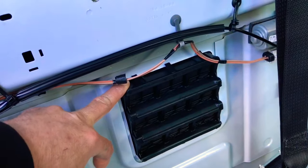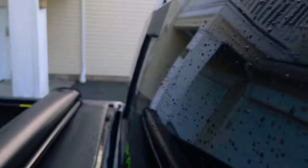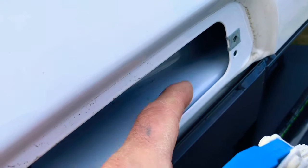So that was step one — the window — and step two was the vents. Now what I haven't done yet is put water in at the third brake light. I've got a squirt bottle and I'm gonna squirt water in the seam right here. I'm pretty sure it's leaking in here.